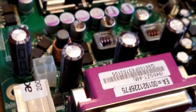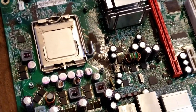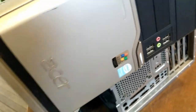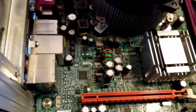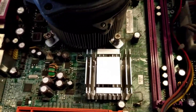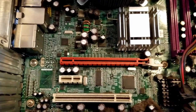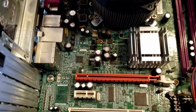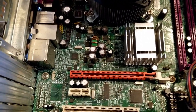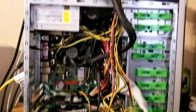Looking at the capacitors on this board, they're all bulged on the top, so I've got a few more boards to check. I then found another one that seems to be in a little better shape. On the inside it is dirty, but just not quite as dirty as the other one. The main thing is the caps on this one, at first glance, appear to be good. I'm not going to take a chance with the other board — once caps start to go, you'd have to recap it, and these probably aren't worth recapping. So I'll pull this mainboard out and use it instead.